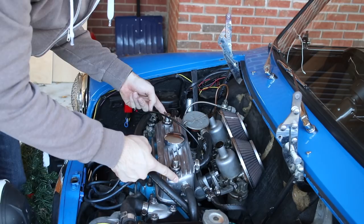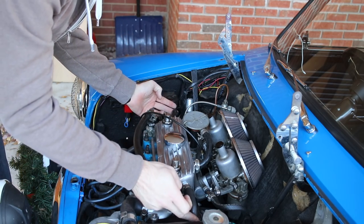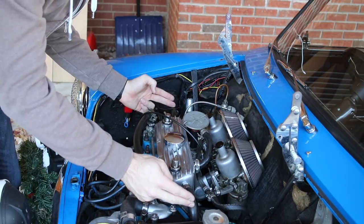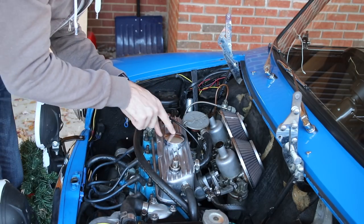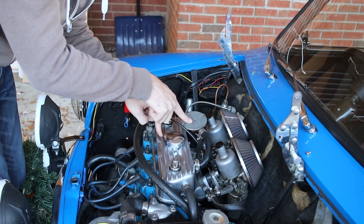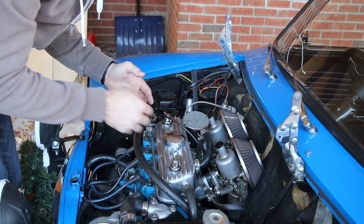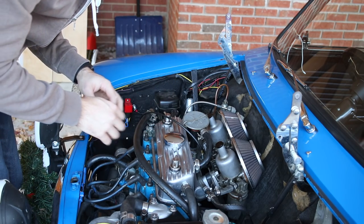It was nerve-wracking drilling holes into this valve cover, which I really like. These hoses come in — I have a timing case breather, which is unusual, and not all Minis have a crankcase breather either, but if you do, it'll be right over here. Both hoses allow blow-by gases that build up inside your motor to pass through. They move into my valve cover — this is a vented cap — and an additional hose comes off the back, goes into a factory PCV valve, then into the intake where the gas is reburned. Previously I had a spaghetti layout of hoses going straight to the PCV, which was getting gunked up with oil blow-by.